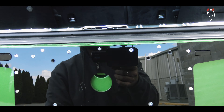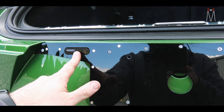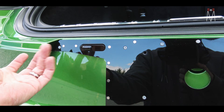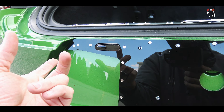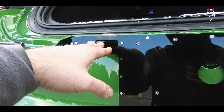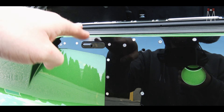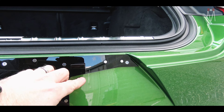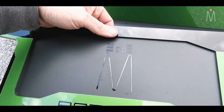That's what most people get wrong in this category — a lot of installers will stick these in spots that look good but follow wherever the rear end of the car is angled. In this case we don't want any more than a two degree variance from completely level with the road. Then of course we need it to be level with the ground. And then you have your TX right there, and your plate frame.